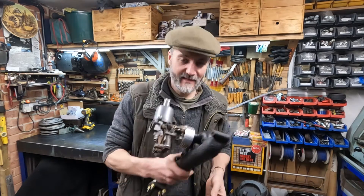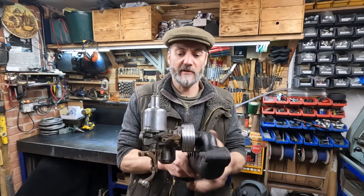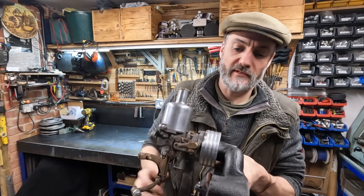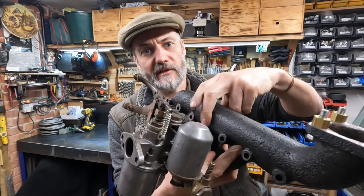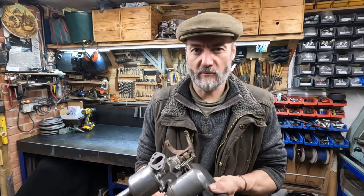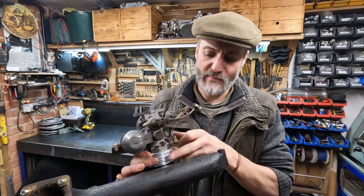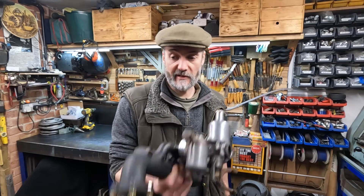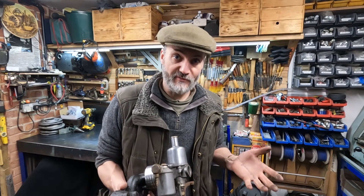So here we go. We have the inch and an eighth SU carburettor with the adapter. As you can see, like I was saying for that relief, you've got full travel on the throttle now with nothing interfering. If you look at the bottom you can see that you have got enough clearance to get all the bolts on the manifold, so nothing's going to interfere. On my other car that's got an inch and a quarter carburettor on it with a bigger carburettor adapter, I did actually have to machine part of the bottom away to get it to work. But it all works pretty good. So all that's left to do now is bolt that on the engine, which I will do, and then we're ready to put it in the car when we actually get a bit further with the car.